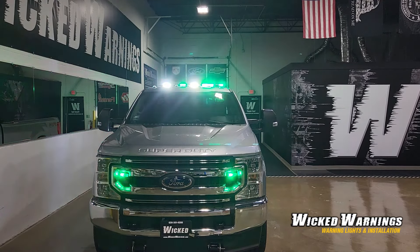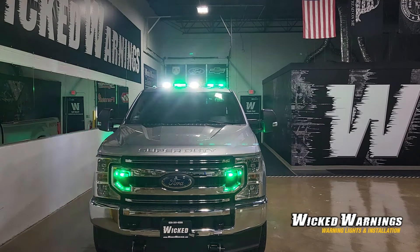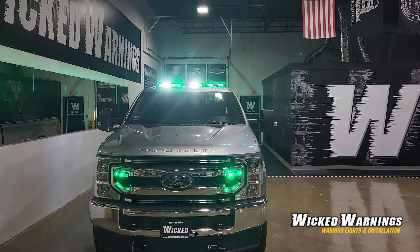Synchronization and patterns are completely user selectable. Above that, we've got a Phoenix Fusion 49-inch light bar. That was custom ordered in green with a couple of white heads in it. Nice mix of green and white, and we have the alley takedowns flashing in that light bar currently as well. It does have takedowns and alley, and we've added in two additional white heads in the front for the takedowns.